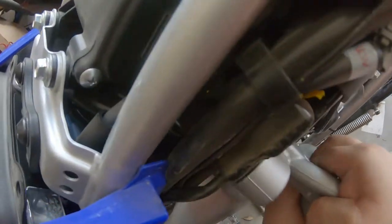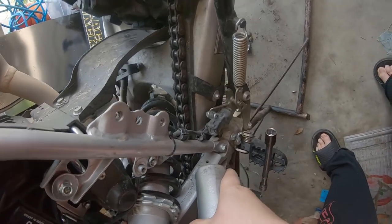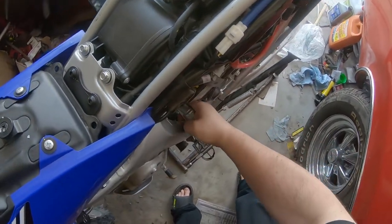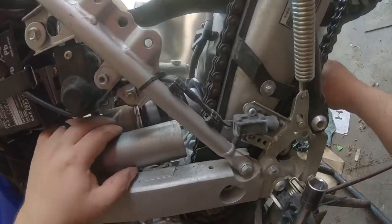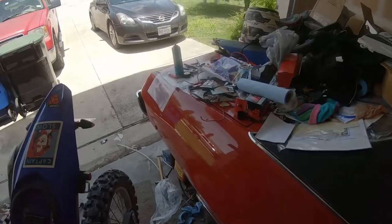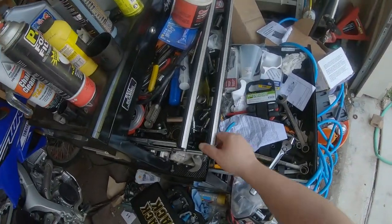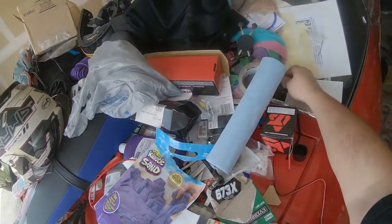Now the manual didn't say anything about having to remove the battery box or any of that. But so far we're being a little difficult here. This looks like that's the bottom flapper AIS that's interfering with me pulling this out. Yeah, I didn't figure it would be that easy. Well, alright. Too big to pull out of the bottom. I'm gonna take this AIS off. Much to my chagrin. It doesn't specify to, but just because it doesn't specify to doesn't mean that you don't do it.